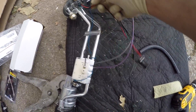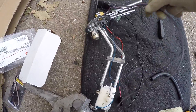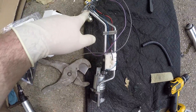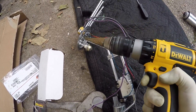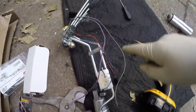The fuel hose is on. Next thing I'm going to be doing is wiring this guy up. My plan is to leave this whole connection alone up here - I'm just going to cut the old power and ground wire short up here because the sender wiring is going through this. Then I'll just drill another hole in the top, put a grommet through, and fish my two new pump wires through that. They are going to be a lot thicker than the factory ones - I'm going with 12 gauge. I'm just going to drill a 3/8 hole with my christmas tree bit right through the top, pop the grommet through, and then get to soldering the wires on the pump and fishing them through.